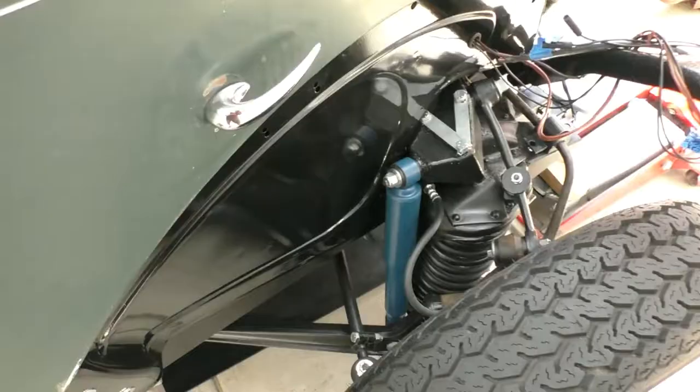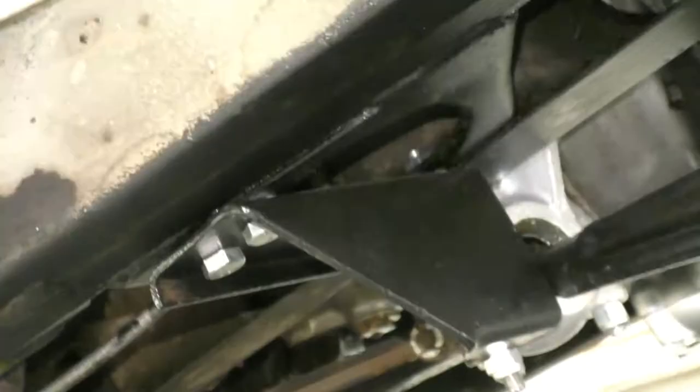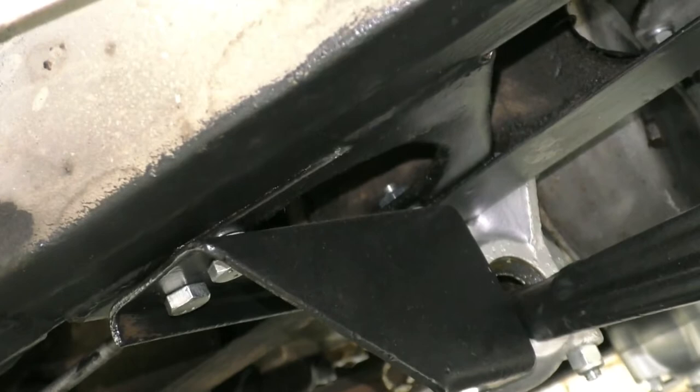Here's the radius arm going into a housing. I had to do a bit of repair on the housing, which was slightly damaged on both sides. As you can see, I put all new high-tensile zinc-plated fasteners in everywhere. On the other side, after replacing all the fasteners, I also made up some new tab washers — a washer with a tab that folds over the hexagon part of the bolt to stop it from unwinding. That's a fairly common feature on a lot of the suspension parts on the Rover, just so nothing falls apart.